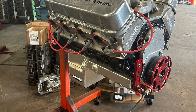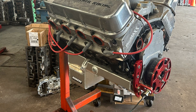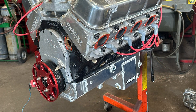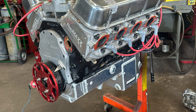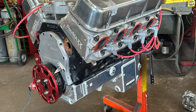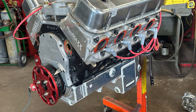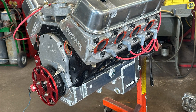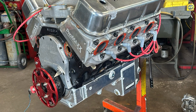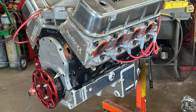The pan was shifted over too much. These are a pain to deal with because essentially you have to have the pan upside down, lifting up to put the bolt in, and if you drop it you have to take the whole pan off and start over. The original plan was to dyno with the hamburger pan and the Titan oil pump first, then switch to the Moroso pan. But Gary had spent three hours putting this pan on, so I didn't feel like saying 'hey let's take it off to put the hamburger one back on.'